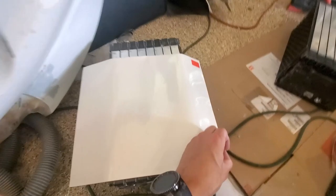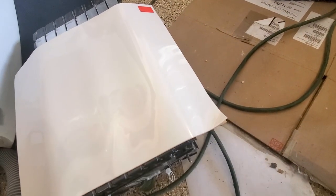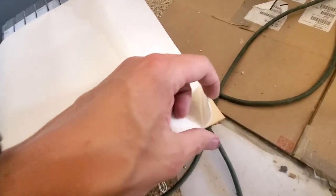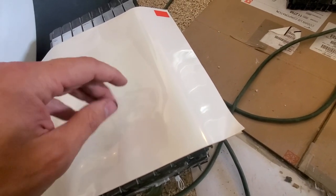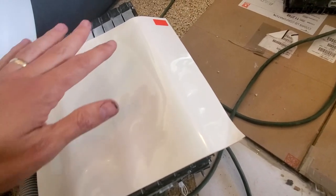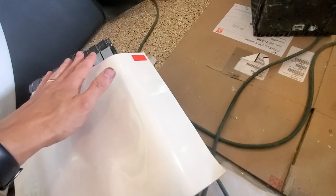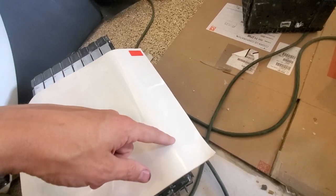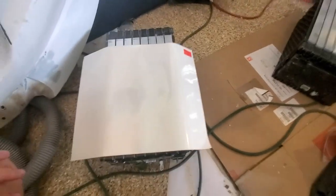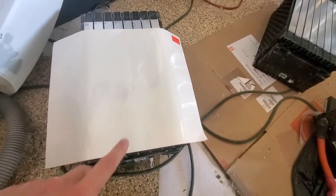I got the thermal pads. They've got film on both sides, and they're a little bit tacky on both sides. I think one side might be a little more tacky than the other, but it's not sticky in a way that would leave a residue. When you feel it, it's like feeling aluminum versus cardboard: it feels cool to the touch, even though they're the same temperature, because one wicks away the heat. This one has that same sort of feeling. I don't know quite how to describe it, but I'll cut these and apply them to the battery modules and start putting them in place.